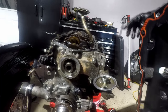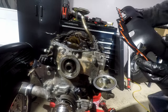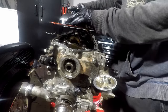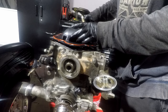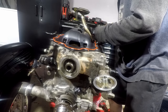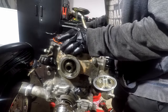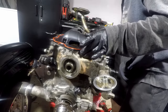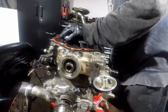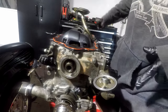When installed under the car, I rub my finger along to smooth the RTV so the gasket install doesn't get messed up. With the engine upside down, it's easy to fit the gasket in, line up the holes, and set it gently on. Making sure every hole is lined up. Giving it a minute or two to tack up, then we'll do the same on the top side and install the oil pan.